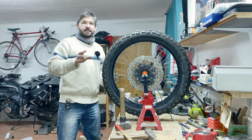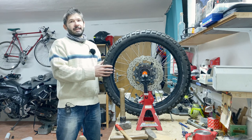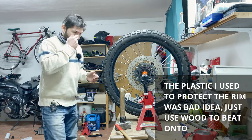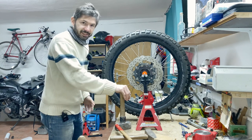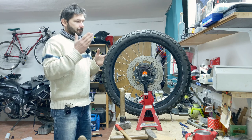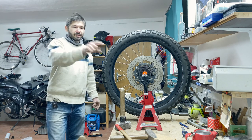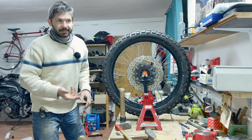The tire is on and it seems the rim is fixed — there's not a single leak, which is pretty amazing. Now I know that a dented rim is not the end of the game, which was always my big question. I'm really glad I went through the process despite it being frightening at the beginning. I did scuff my rim a little being silly, but the outcome is that anywhere in the world — any small village with a hammer or a workshop with a press — can fix a rim pretty easily. I can keep running tubeless and trust it. The ability to fix punctures with a mushroom plug is absolutely amazing. For trail emergencies I also have a spare tube I can squeeze into the front or rear to get out of trouble.